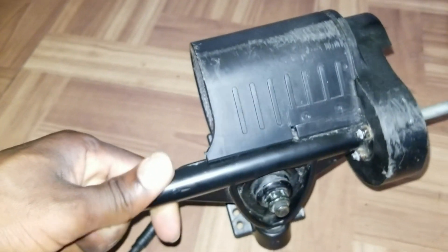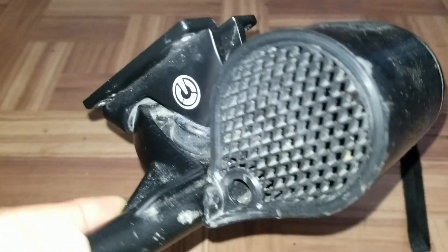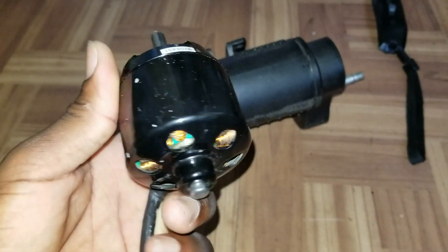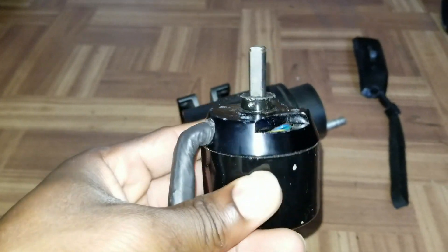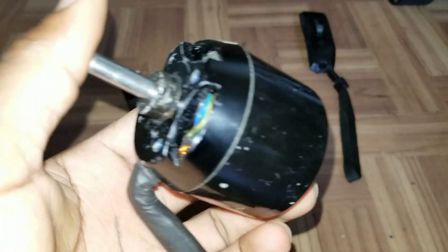Originally the Unique Eagle comes with this setup — it has a very nice truck and the motor was nicely covered from debris. It uses its own proprietary setup and the motor doesn't have any markings on it. I can't figure out how many kV this motor is, but I know it's for a 7S battery, which isn't great because it's pretty slow and considering the size of the motor it doesn't have that much torque.